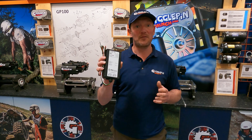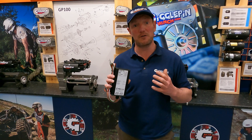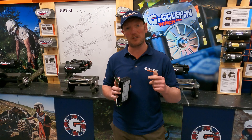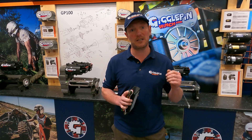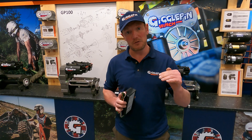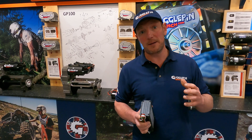Well, we do it with these. These are voltage drop boxes. They drop the voltage from 24 volt to 12 volt, and not to be confused with voltage converters. A voltage converter will take 24 volt, halve the voltage, and turn it to 12 volt. The problem with this is that when we're actually in use, our voltage can drop when we're winching.